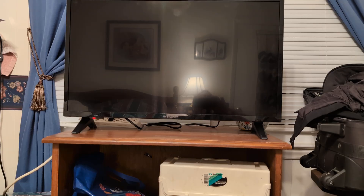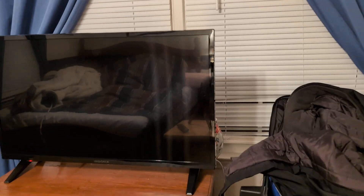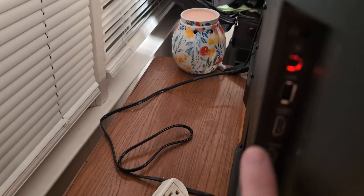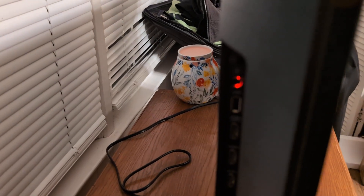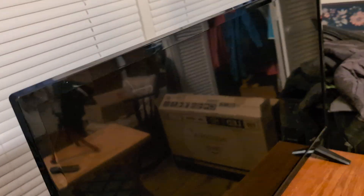After you've tried that and you're unsuccessful, next look on the back of your TV at the HDMI ports and see if you have anything connected. If you have an Apple TV, a PlayStation, or an Xbox, go ahead and temporarily disconnect those, then try to power the Insignia back up.